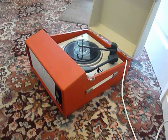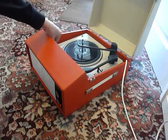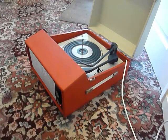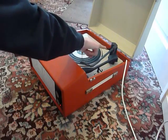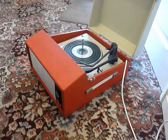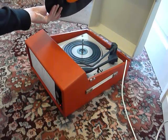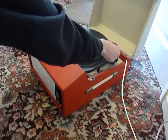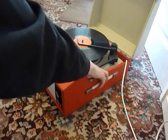I'll just demonstrate with the start of a 12-inch record as well. When you stack a 10 or 12-inch record, the black horizontal lever that sticks out here is the size select arm. You need to make sure that the record is stacked above the black lever like that, so that the arm knows to land in the correct position.